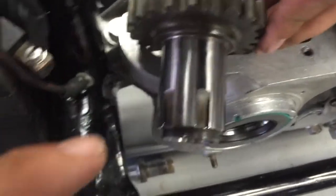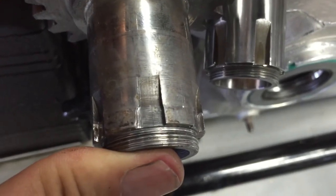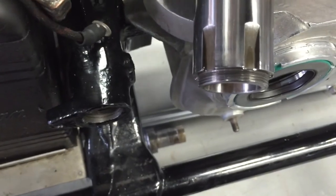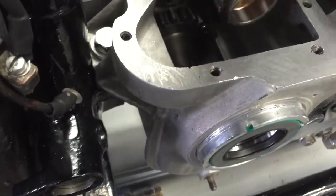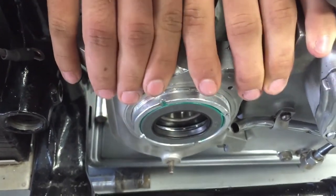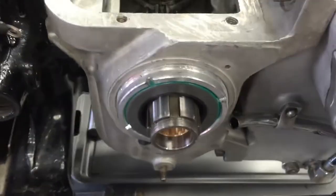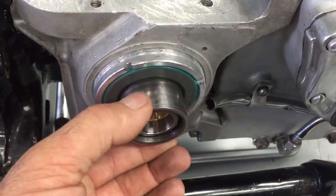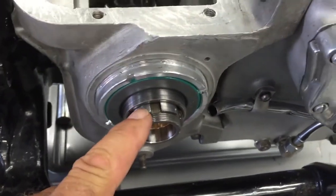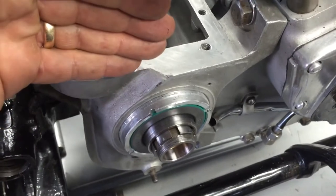Now inspect your splines — make sure they're in good condition. This one here is like brand new; this one here has got a lot of use on it and the sprocket has become loose. Don't go ahead and use that one, because it'll actually get worse and worse and just slog out. So make sure the splines are in good condition. Now put the sprocket driver gear through the bearing with a little bit of oil on the gear snout itself to aid going in. Next up, put the collar on with a little bit of oil on the collar so it doesn't burn up the seal. Put the sprocket and the nut on — that'll capture all this to the right side of the transmission case.